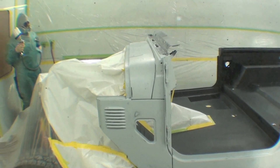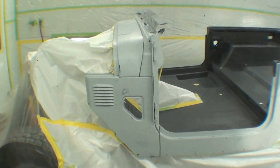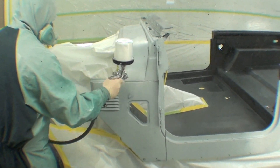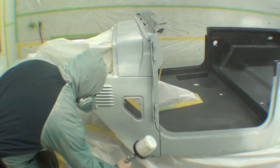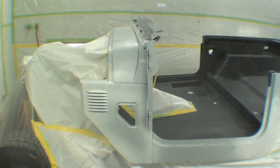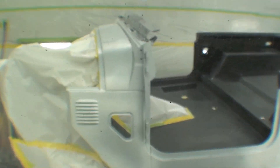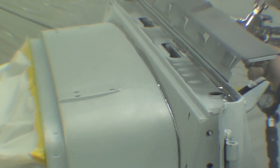The process commences with putting on the sealer, then the base coat and clear coat — all the color. They've taped out the whole body, frame, and tires, and Matt is applying the first round of sealer. Just a note before he gets the sealer on there: you can see that seam sealer was applied on all the grooves — that gray material right there at the joint on top of the cowl and whatnot.